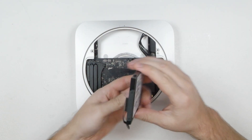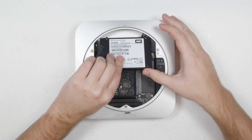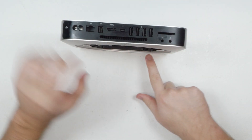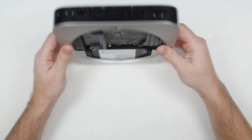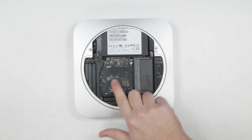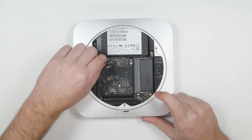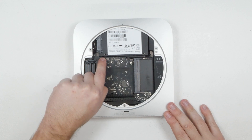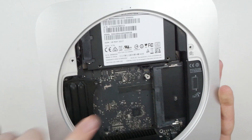Now put the drive back into the Mac Mini. It can be a little difficult to get the two screw posts back into the recess holes. The best way is to get the drive in loosely, then turn the Mac Mini and stand it up so the drive is resting near the bottom, and fiddle to get the screw posts into the holes. Once it's seated, plug the drive back into the motherboard — use the left-hand side plug, not the right. Line it up over the top, move it around until it drops into the plug.